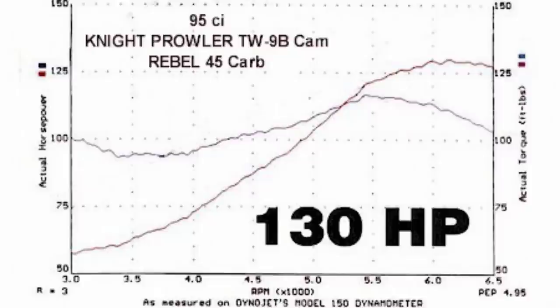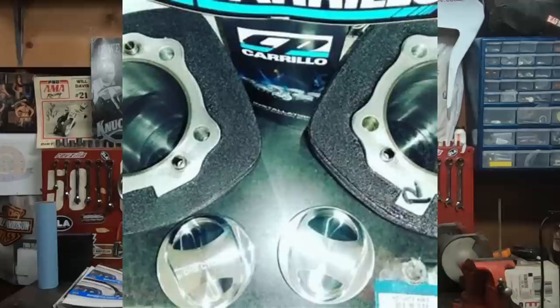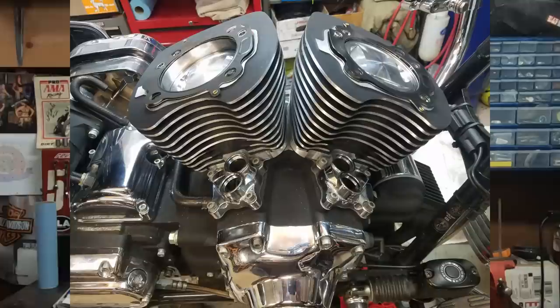With that really short stroke, this thing's going to spin up really quick — you'll be into that torque and horsepower in no time. The 95 is not a lazy motor. Some of these big long-stroke, big bore engines have power that comes on a little slower. With the 95, it's a different ride, but a lot of fun. The 95 is very cost-effective because it's available right off the shelf, and you can bore the stock cylinders out, or S&S has a 100-inch bolt-on kit — but that's about $1,100, and you'd still need to add a cam.